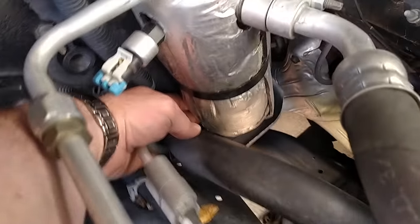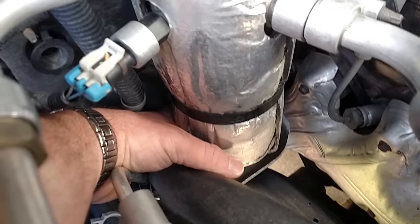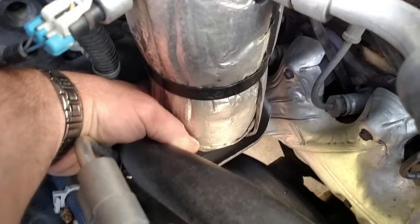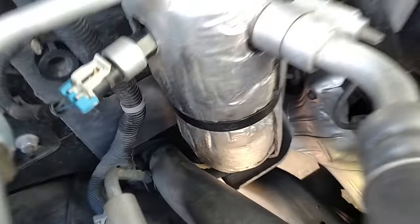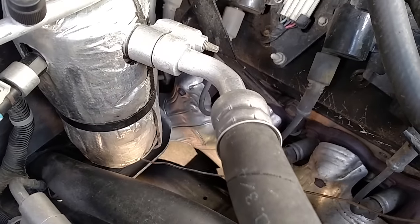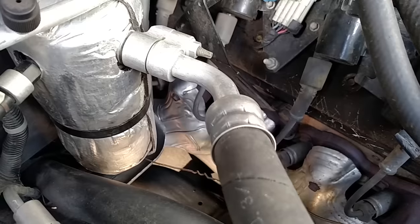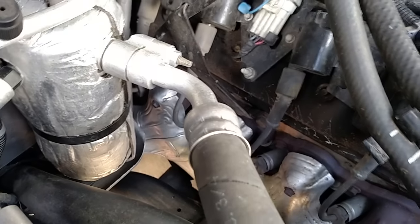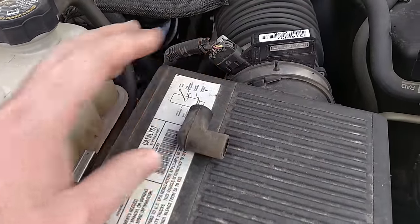What you've got to do is reach back in here, underneath, and it's up against the firewall. You can feel a tube back there, just barely with your fingers. I pulled my boot off and you can run a wire in from this direction — don't jam it in there, but push it in slightly, and then you'll feel it stop. Wiggle it around, push it in and out a few times. That's the front one — you've got to pull that off, that might be kind of a pain to get back on.